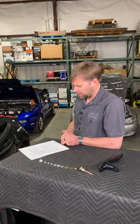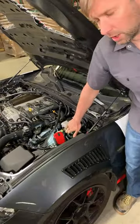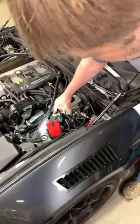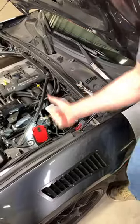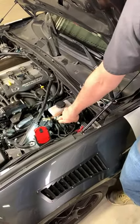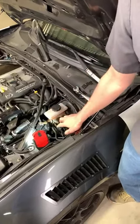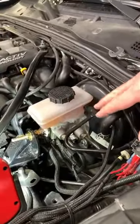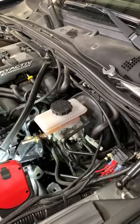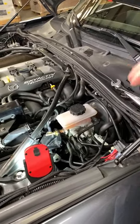Would the constant pressure cause any damage or premature wear to the brake master cylinder? No. You do need to preload the little foot here, and the foot can deflect just a little bit, which helps with alignment. But basically, you're not trying to cram the master cylinder that way — you're just trying to keep it from moving. You preload it just a little bit, and that is on the body of the master cylinder, which has absolutely nothing to do with the hydraulics inside of it. You're not creating constant hydraulic pressure or anything like that. Short answer: no, it makes exactly zero difference.